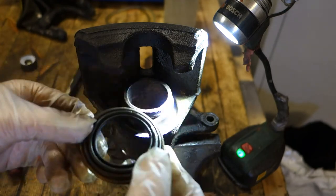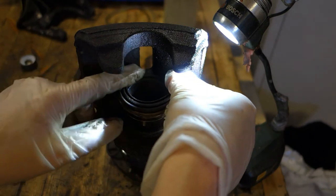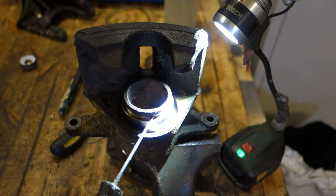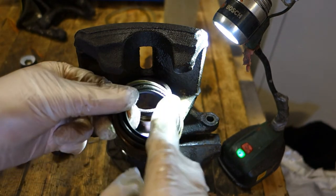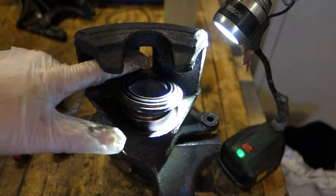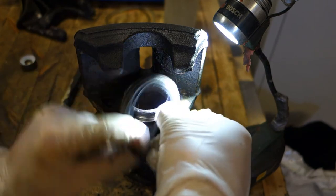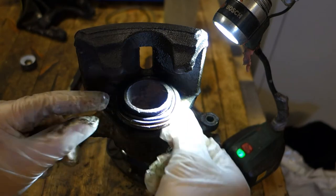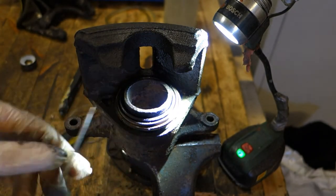Look, it looks different. The first step is to insert that gasket in that hole. There is a hole in here. This hole. And this upper part goes in this hole. It's good to start in this area, because this is the most difficult area. And then when I stretch that a little bit, we need to stretch that gasket, and now it goes in that hole. Look, now it is nicely in this hole.